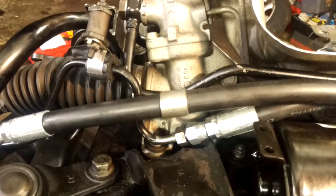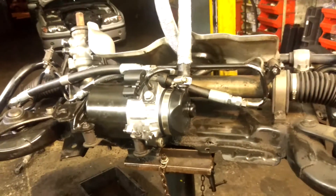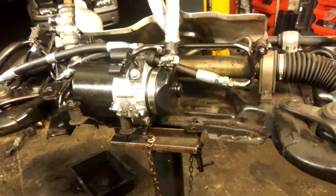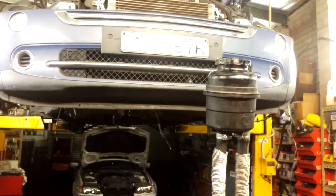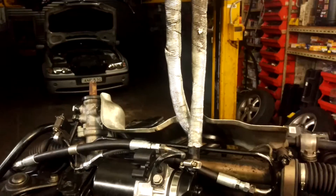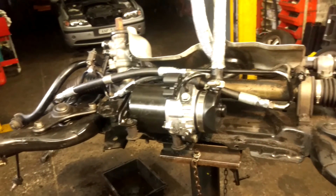No wonder it took them five years. I normally gurney all this down, but I've cleaned it as best I can for now and tomorrow I'll wipe it all down again. The oil leak on the front — I find a lot of the time it's from the O-ring on the crankshaft sensor. And that's the quick video — it's now seven minutes long. Don't try this at home. Bye.